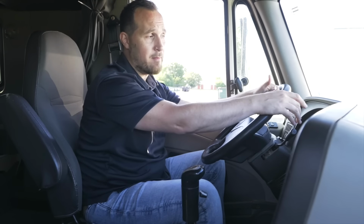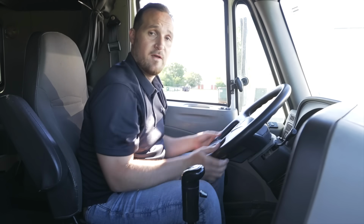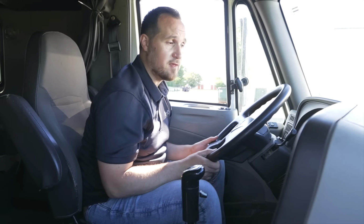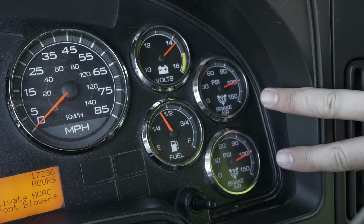Now we're going to move on to our braking tests. Now remember, do not forget your braking test. Let's start our braking test. First test I'm going to do is my lab test, leaks, alarms, buttons. So I have to tell the examiner I have at least 100 PSI of air or more, and my air tanks are full, which they are. Then what I'm going to do, I'm going to put my vehicle in gear.